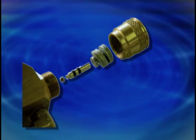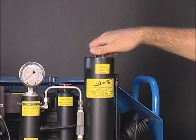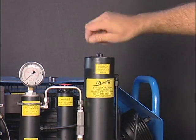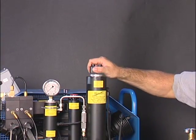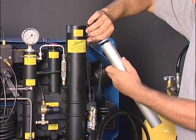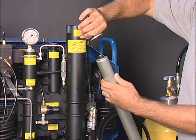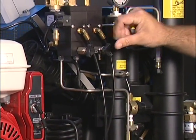The pressure maintaining valve can leak air back into the tower and cause death or injury. Use a wrench between the two Allen head bolts on the top of the filtration tower. Turn the top counterclockwise to open the filtration canister. Place one hand on the filter and one above the filter and turn counterclockwise. Install the new filter and lubricate the threads as needed. Close the drains and open the storage to resume operation.